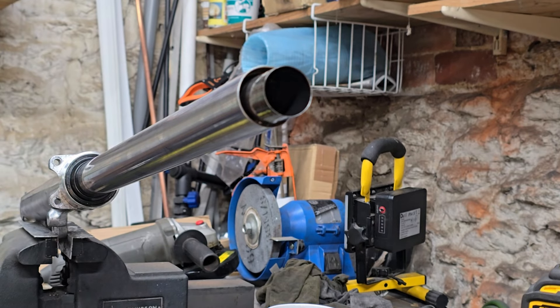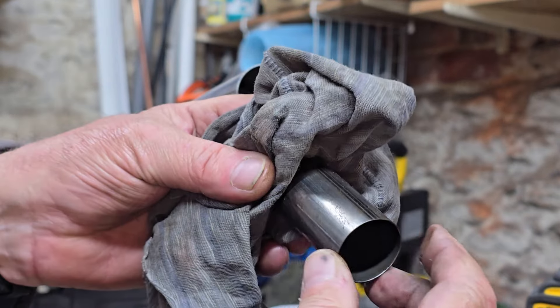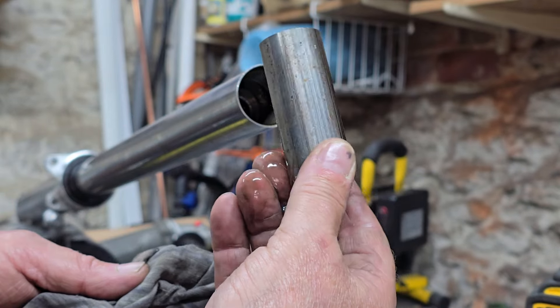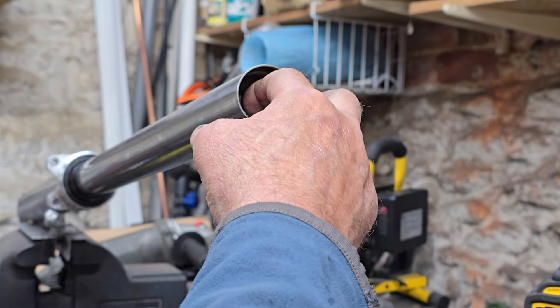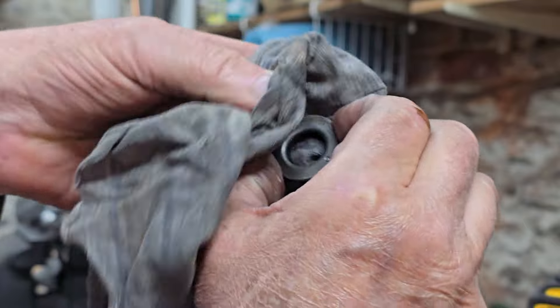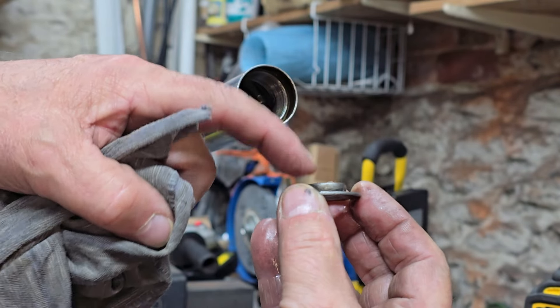What I'm going to do is lay these parts out on the bench in the order they came out. Next to come out is a spacer - that one doesn't necessarily look factory to me, maybe somebody has put a bigger one in there to try and increase preload. Then we've got a little washer, or what they call a spring holder, that sat in the top of the spring.